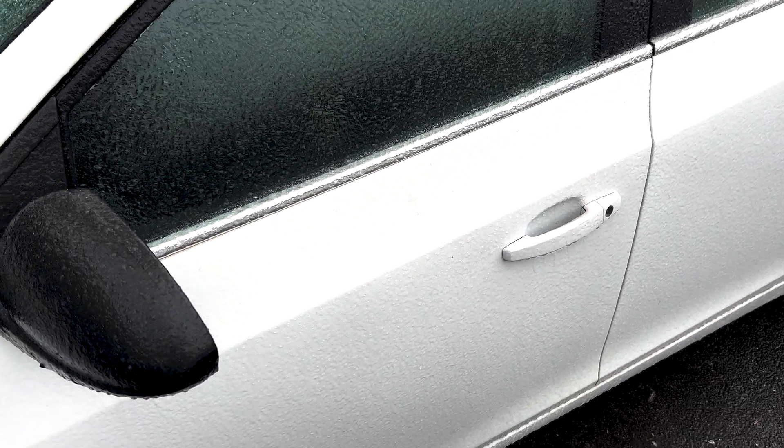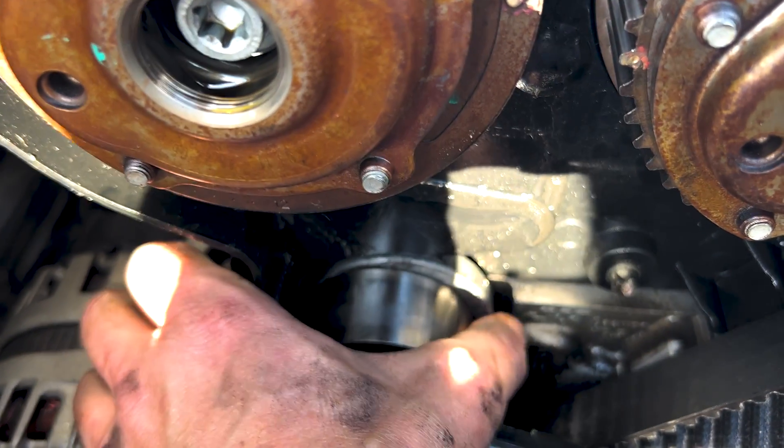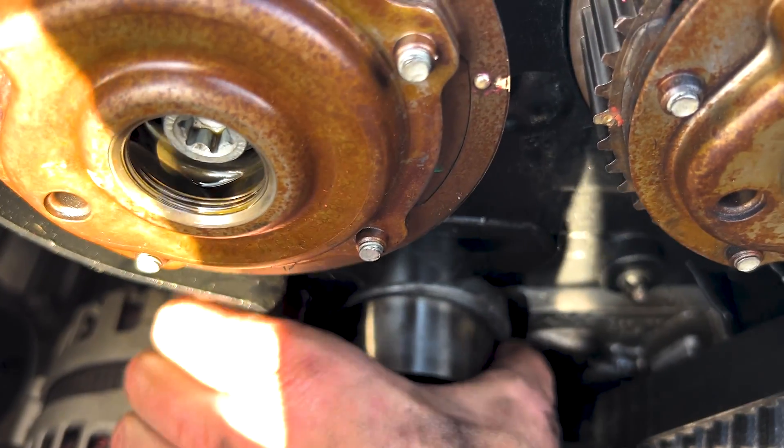I took some time to put money back into this project. I've got a lot of stuff lined up, but let's go ahead and have a little fun on the street and tune the car some more. There's an issue I've got to fix — the tensioner on the timing belt during this past winter started clacking. We'll fix that real quick and take it for a rip. This thing has no tension on it — you shouldn't be able to move that by hand. This thing is jacked.